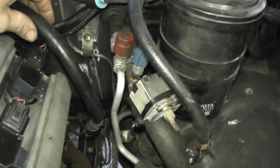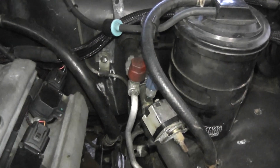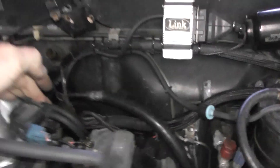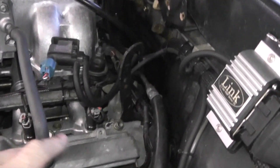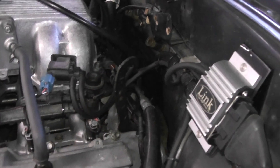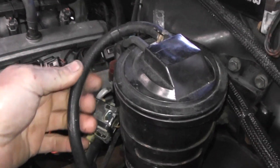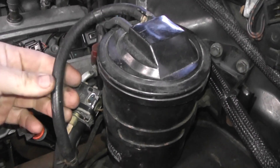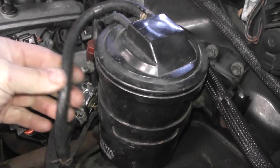The inlet hose for the fuel line, right here, has to be high pressure line. You'll see I've brought it up and put it directly into that dampener at the back. There's the charcoal canister, the breather for the fuel tank — an emission hose. Generally a fuel hose is okay there; doesn't have to be high pressure, can be low pressure.